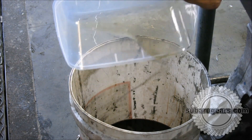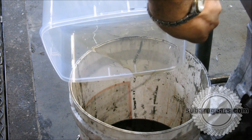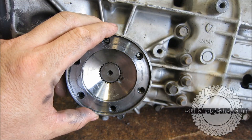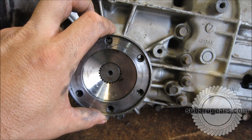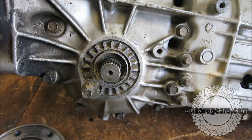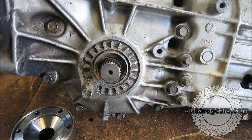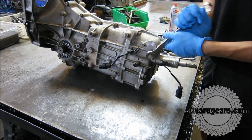So I'm quite happy with that result for 13,000 kilometres of testing — that's street use and sand use, jumping it in the dunes. That's where the OBX LSD is fitted. Also having a look at the super flanges, they're nice and tight on the splines. They haven't produced any rocking. You can see there's a little bit of backlash which is very much within normal specs, particularly for the OBX torque sensing type limited slip transmission.